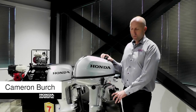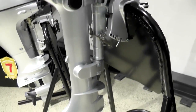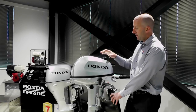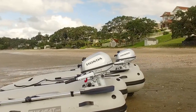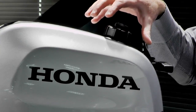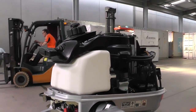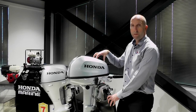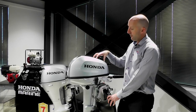Thanks Sarah, I'm Cameron from Honda Marine. We're here today to look at the BF 4, 5 and 6. Specifically I've got a BF 6 on display here. Within the new range, the 4, 5 and 6 are all the same physical size and weight, and we have two variants available with the short shaft 15 inch or the longer shaft 20 inch. Some of the key features about the new 4, 5 and 6 is they've all got a built-in 1.5 litre petrol tank. That's the largest fuel tank available in a portable engine. We've got the option of an external tote tank. So it gives you great range.